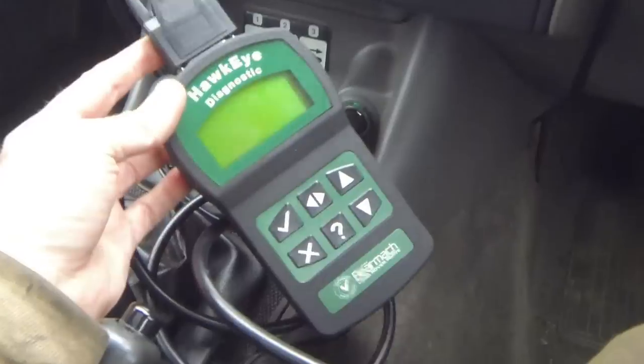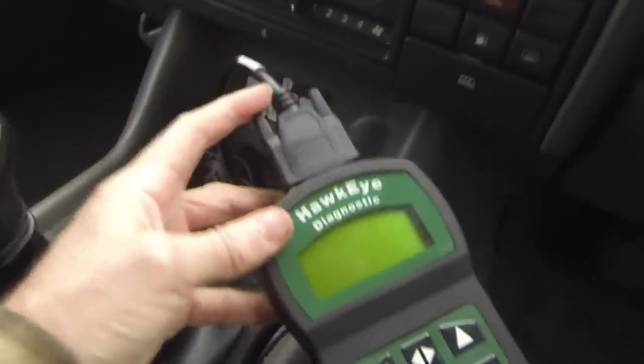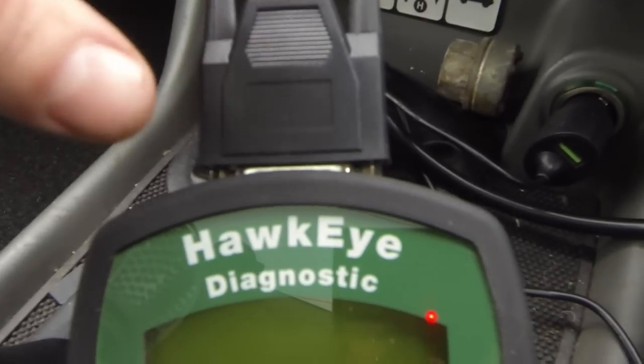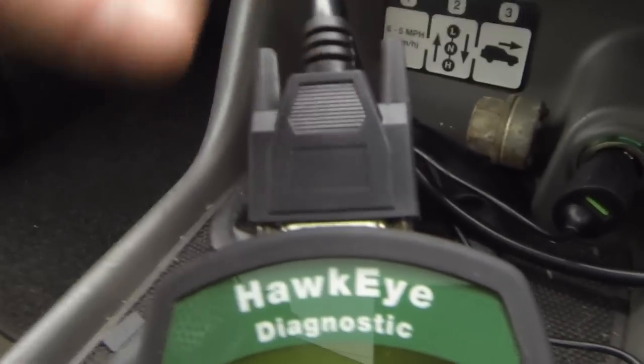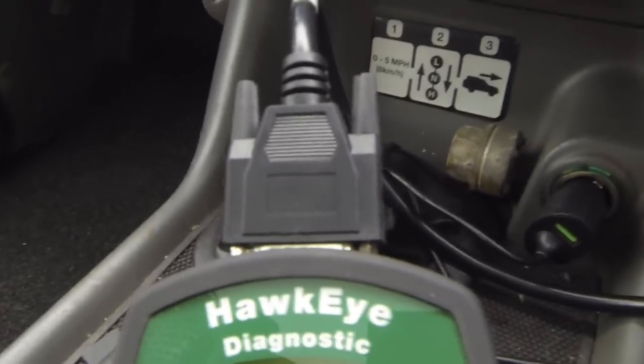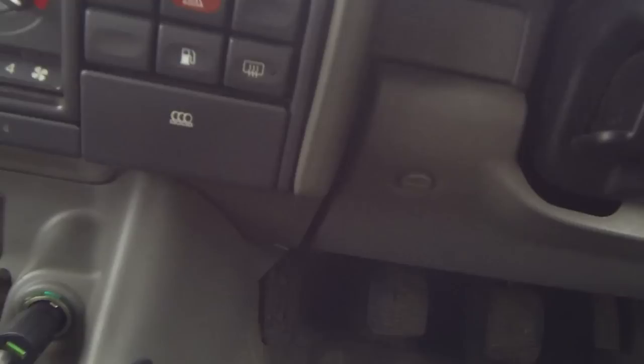What I will say about this — particularly when I come to the Nanocom in the next video — make sure you plug this end into the tool first. With this connector it's quite easy to misalign it and touch the wrong pins together. When I did this with the Nanocom I had a big blue spark, something went snap, and then nothing worked. I'll talk about that in the next video. Best thing is to plug it into the tool side first, tighten up the screws, then go and find the OBD port to plug the other end in.